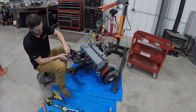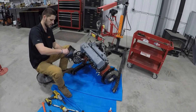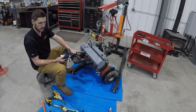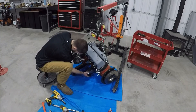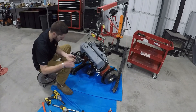Then this slides in here. Then the nut goes on there — holds it on like so. This side goes to the frame rail; this side goes to the engine. So once you get everything stripped off the engine, this plate goes right on here. Nothing goes behind it, nothing goes in front of it — just the motor mounts by themselves.